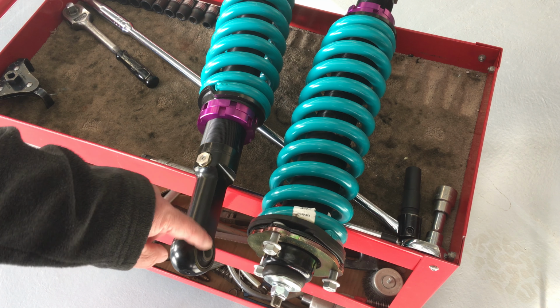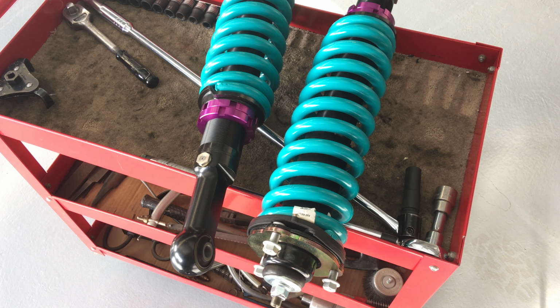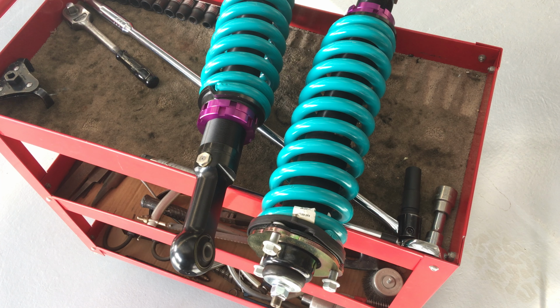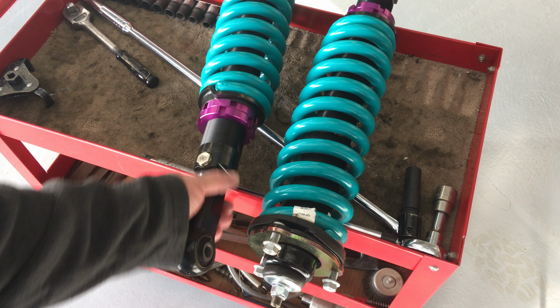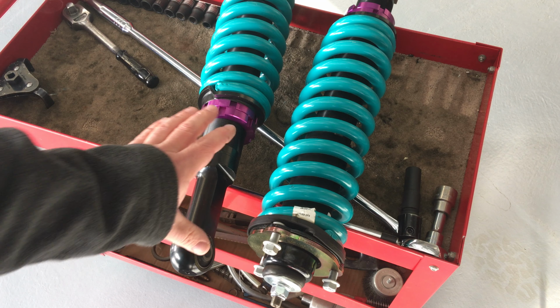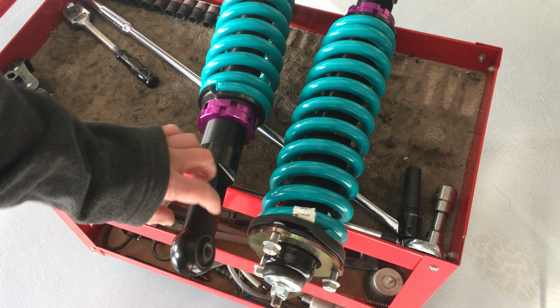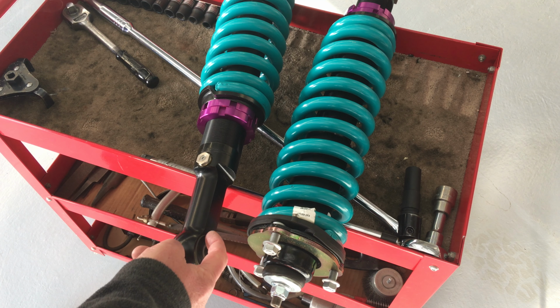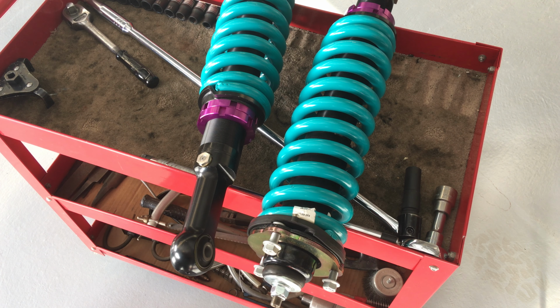But what can happen is these uprights, the stock standard ones, because they're so small, two things can happen. They can bend, okay? So this part that goes up here, again, you've got to look under your car and you'll see those little twigs there. I like to call them twigs. This is rock solid, mate. There's full on strength here. So what I'm trying to say is, if you've got suspension like this or anything like it, something with a decent strong upright with 360 degree welds around there, it's pretty damn strong.